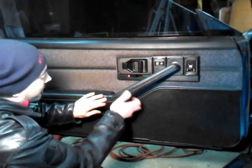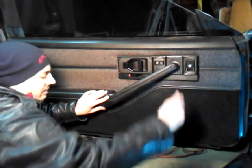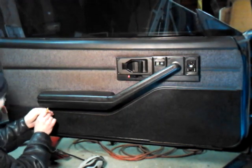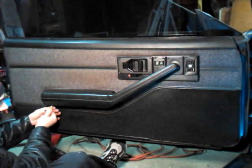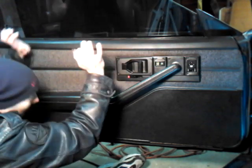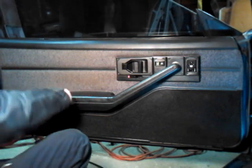So, this bad boy in there. And you got one over here. And one over here. And I'm done here. Just gotta tighten these up. Now remember, this, sorry about that, but it took me a little while. When you push it in, you also angle it down this way, down that way. So push in, angle down, it'll slide right in. That's the technique to get that top of this top piece over here in. And that's how you take off and install a door panel.